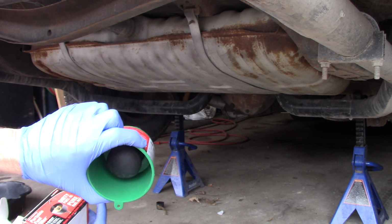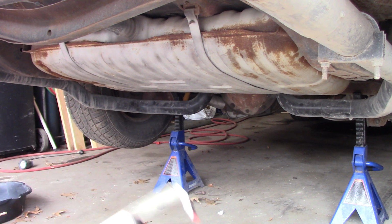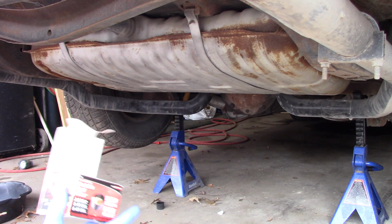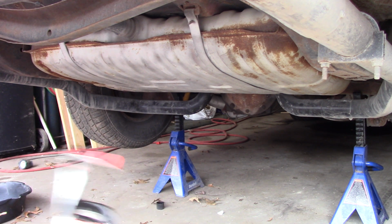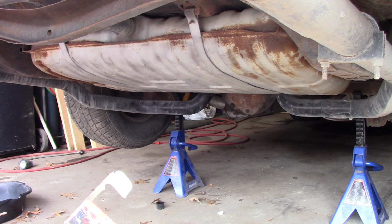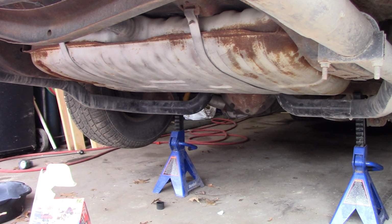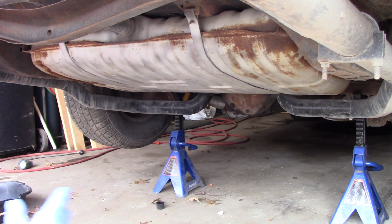Then when you pour it in from one to the other, you're trying to get rid of the garbage out of it, whether it be leaves or whatever. Generally, you don't get that stuff in gas, but in this case, I don't want to drill into the bottom of this. I have no idea what's going to come out to begin with. There may be sediment in the bottom, rust, whatever. That's the reason I'm replacing the tank, because there's so much rust in it. It keeps plugging my fuel filter up. At first it was just doing it every 2 or 3 months, and now it's doing it about every time I drive it. So it's progressively gotten worse. Now, I've been driving non-alcohol gas in it this whole time, but the damage was already done before I got it.